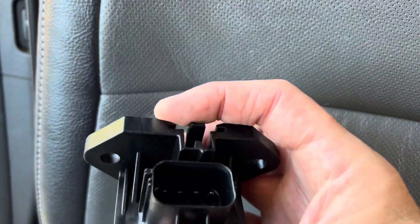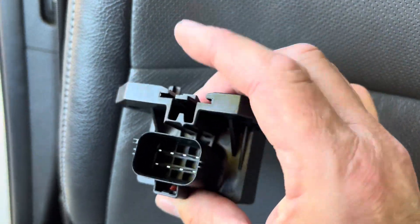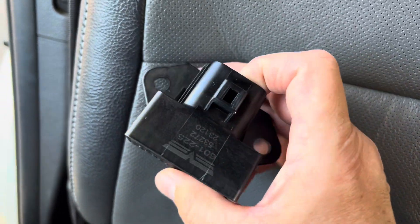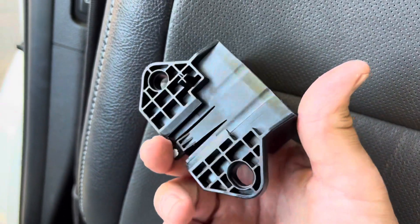Put that in, put this back on — you're back on the road. It's this relay that quits. So that's what your problem is. It's not the fuel pump — unless I'm wrong, let's see how this goes. I'm going to be really happy if this guy solved my problem. Kudos to him, I'm going to leave a link to his video.